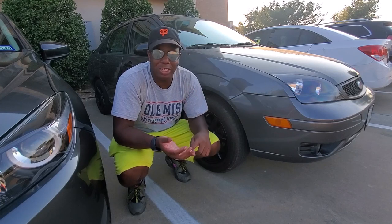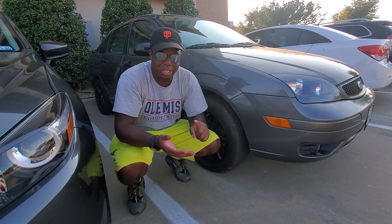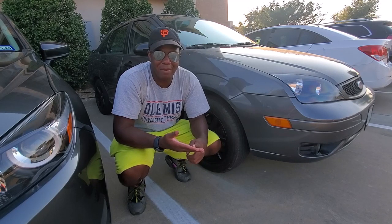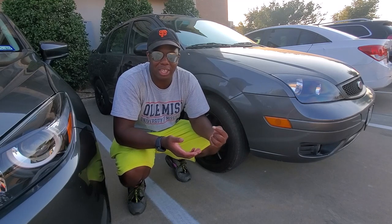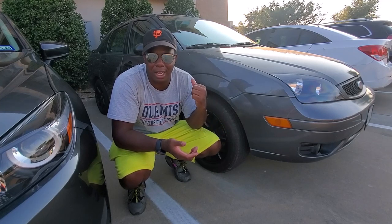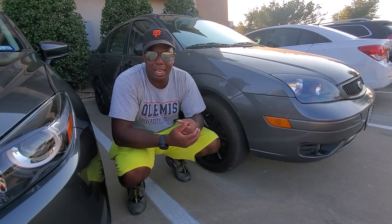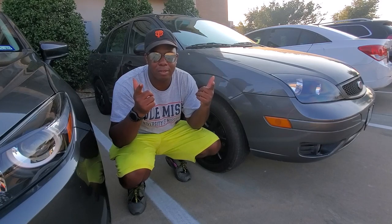There's a laundry list of things you could try. I suggest you check lubrication of the back plate, check the axle, check the bearings, and check to see if the drum isn't round. I've pretty much gone through all the other steps except for changing the axle. I drove the car for about 20 miles and didn't get any knocking noise coming from that rear passenger drum. I'm going to call this a complete job. I'll see you in the next episode of the Ford Focus Rebuild. Stay tuned.